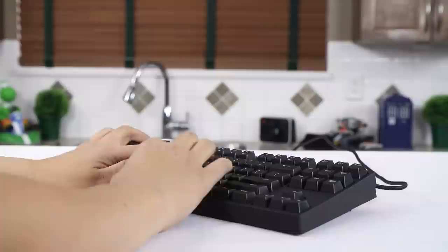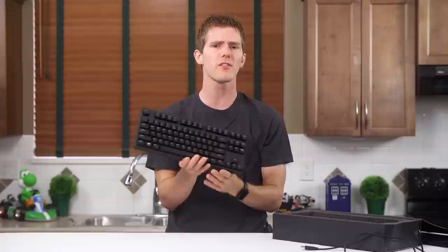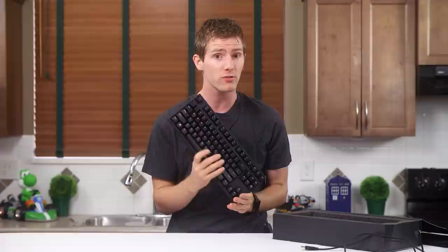But the next question is: with the reputation of Cherry MX mechanical keyboards, why would you even want a Topre keyboard? Most people haven't even heard of it. The typing experience is very different from Cherry, and while I don't really prefer it per se, I was able to adapt to it extremely quickly. Part of the reason is that as much as I advocate for Cherry MX mechanical keyboards and find them generally more comfortable and faster than rubber domes, the keyboard I've typed on more than any other is a Gen 1 Logitech G15 — a membrane keyboard. The Topre typing experience, because the keys contain a spring but use a rubber dome for resistance and tactile feedback, is much like that keyboard, but with a nicer long travel, a more consistent feel and improved comfort.